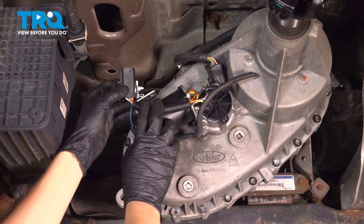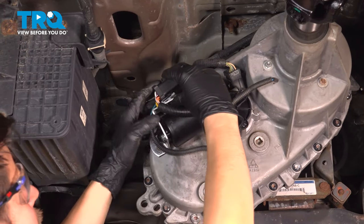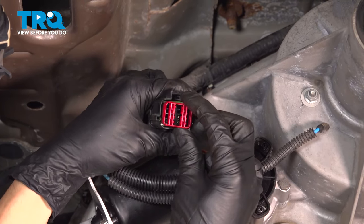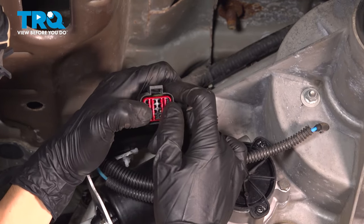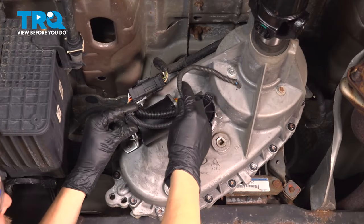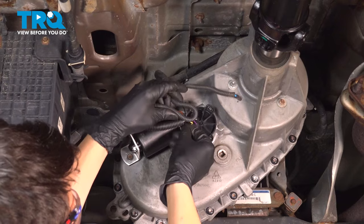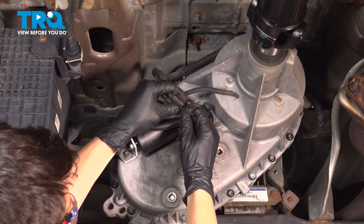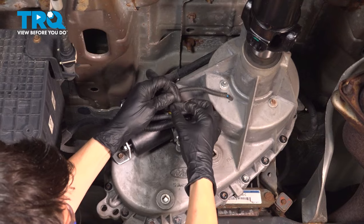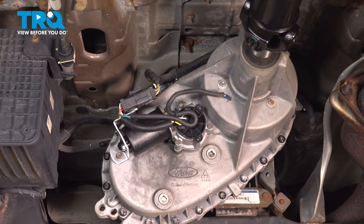Now re-secure this harness with its retainer — make sure you don't pull too much on these wires. It does fit the right way, so make sure it's facing up and clip it all the way down. This red piece that we pulled out of the connector on the motor side is actually supposed to stay on the truck harness side, so press that back in. Reconnect the two harnesses and make sure they click. Now we need to secure the blue wire — take a wire tie and loop it around, tying it to these other wires. You don't want this to be free-floating because if you go off-roading and something catches it, it's going to rip it out. Make it nice and snug and cut off the excess.